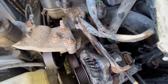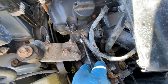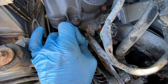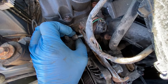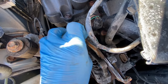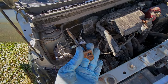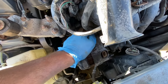Now you need a 14 mil — see this here? You've got to loosen this bolt. I'm going to try to take it out all the way; if it doesn't come out that's okay, we can just move this aside. It'll come out. There's enough room — you're going to take that and the whole bracket off. Just like that. Moving on.